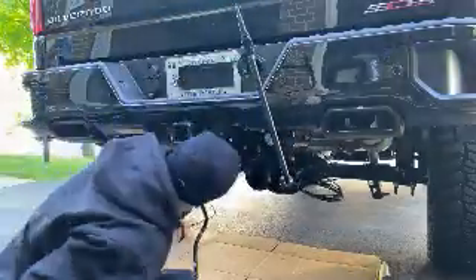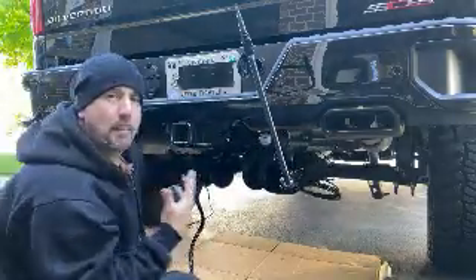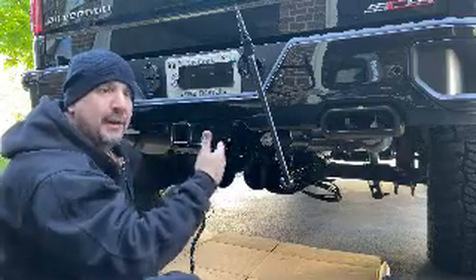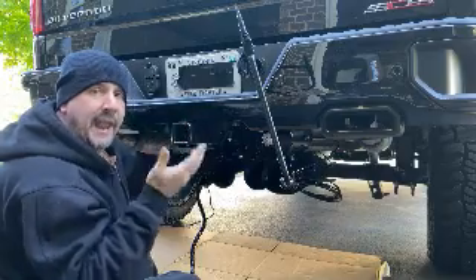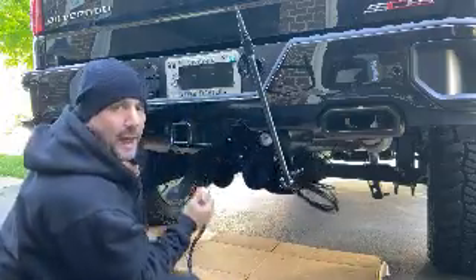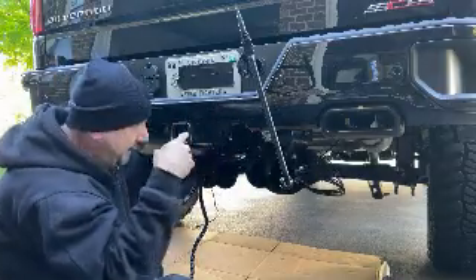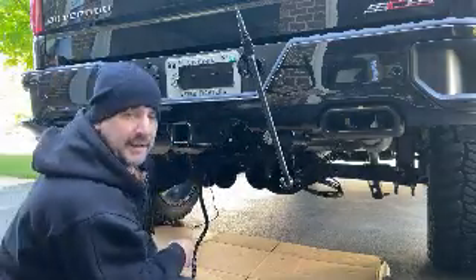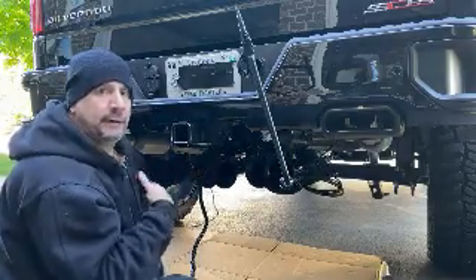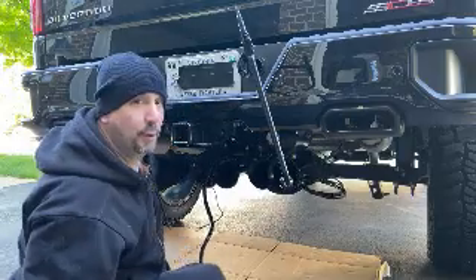All the time that you're doing this, you want to make sure you look at your feet and look at where your feet on this thing are. Because if your feet don't match up with where you're trying to mount it, you may need to adjust your feet either front or back, or left or right. Most people have this mounted where the train horns are facing backwards. You can face them forward, but you do not want to — if water and moisture gets in them, every time you blow your horns it's going to sound horrible.